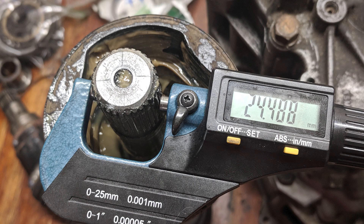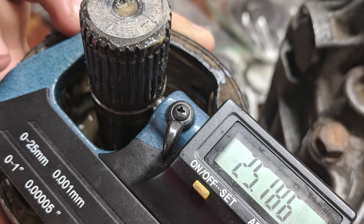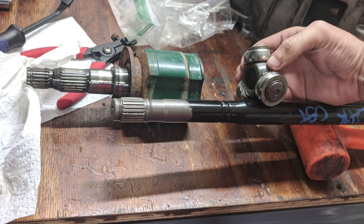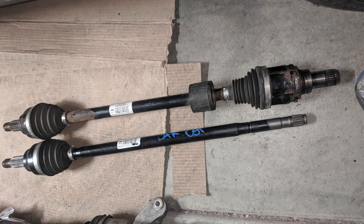Looking at the splines of the different axles, we're noticing that it necks down just before we get to the splines. I was going to try and see if I could re-spline the axles since the Mini SUV axles are longer — I can cut them down and spline them — but I would have to put the CV joint all the way back here if I want to have enough meat to actually make the splines work. So that pretty much throws it out immediately. It would be too short to work with, which means we're going to have to change our approach from simply re-splining to cutting up and welding these together.